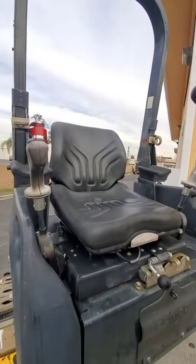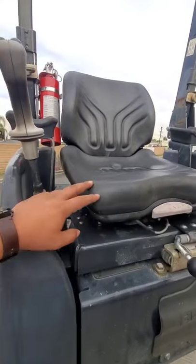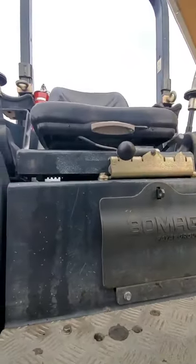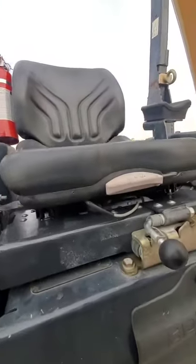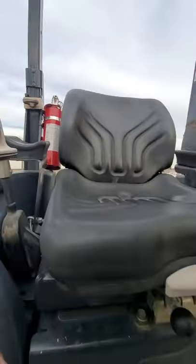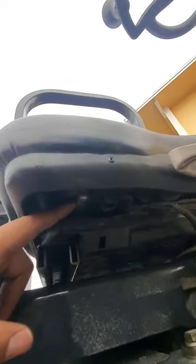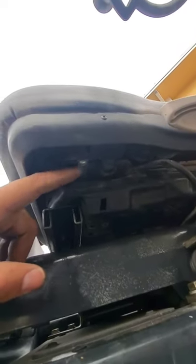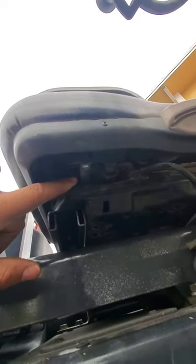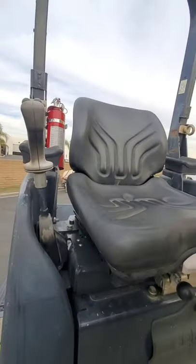There are no videos online right now on how to either remove the seat or work with that little sensor, so I'm going to show you guys how to do it. The very first step is this little screw here — there's a little metal hold-down piece. You take off the screw, then slide this metal piece to the right, and that'll give you access to removing the entire seat.